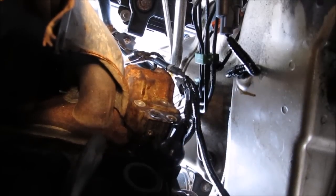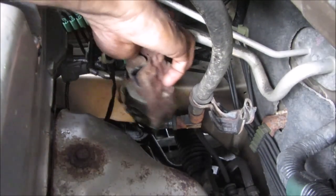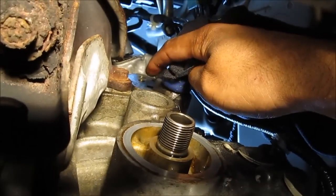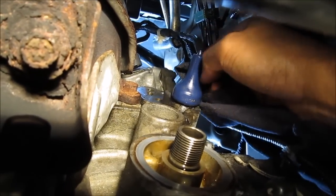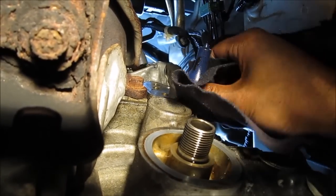We're going to remove it from the top. With all the bolts removed, I'm just going to reach in and remove the VTEC solenoid from the engine block and take it off the car. This here is where the VTEC solenoid sits on the gasket. We're going to clean that area nice and well with a clean rag, use some brake cleaner, and clean this entire area of oil — so that way when you replace the gasket, you'll know if it's leaking or not.